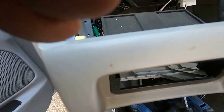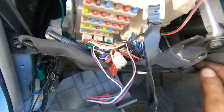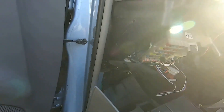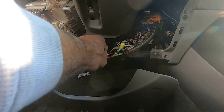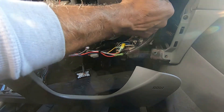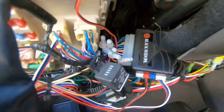That screw dropped down there somewhere, I'll find it. It's got a security system in it — that's probably her failure right there. It's got a security problem. I'm going to pull this steel bracket out of the way. We're looking for a black and white wire coming from the ignition switch. Right there — if you look up in there you'll see a black and white wire. It's aftermarket crap. Let's check it.